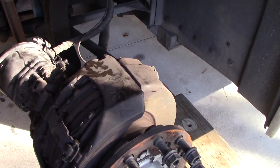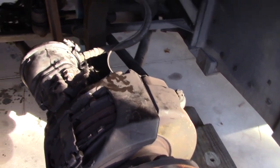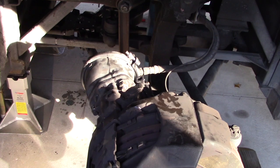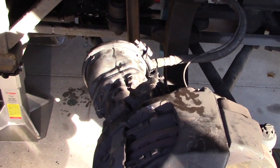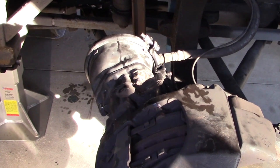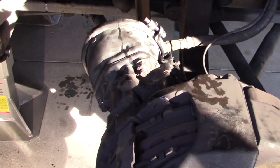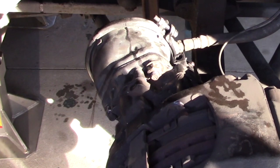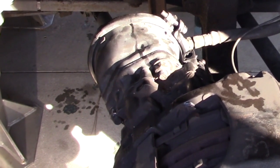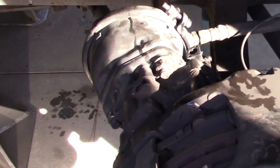These have new slide kits on them that we just got finished doing. Here we'll be able to see the brake chamber. The brake chamber takes air from the braking system and changes it to a mechanical rod to actually apply pressure on those brakes. The size of those brake chambers determines how much pressure is put on the brakes. Unlike a car that would have a system to equalize the hydraulic pressure front to rear based on braking, it's done by the size of these brake chambers.